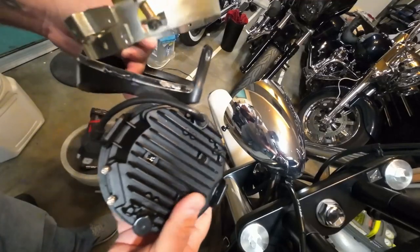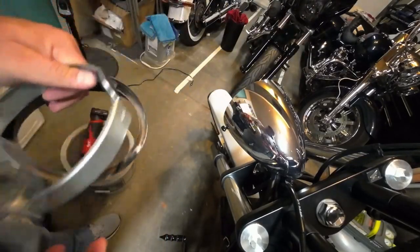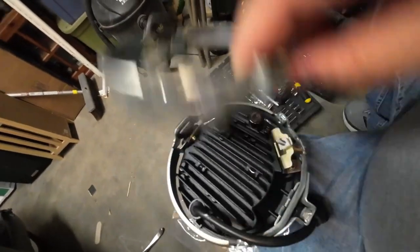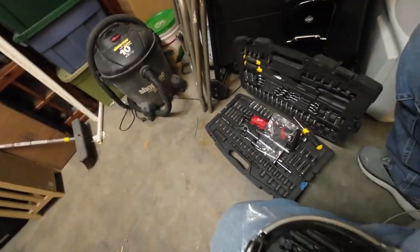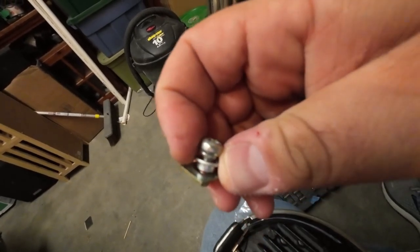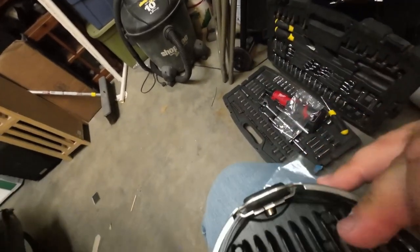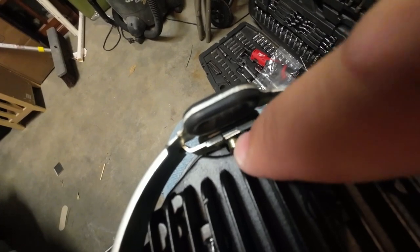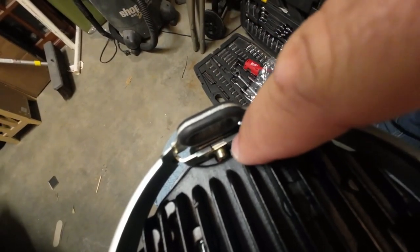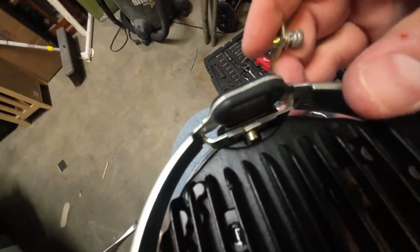This is your adjuster for your headlight — moves it up, down, all that stuff. Your new headlight has new screws that screw into this adjuster. When you remove this bracket from your original headlight and go to put it back on the new one, you will need to save the screws on the top and bottom. There's a plate for a nut, a washer with a spacer, and a screw with a lock washer. This plate with the nut — it's threaded — and the headlight has a notch cut out for it. This is absolutely amazing.